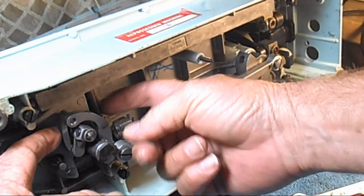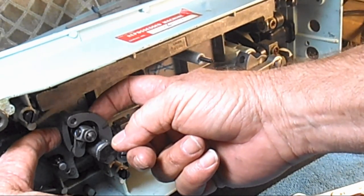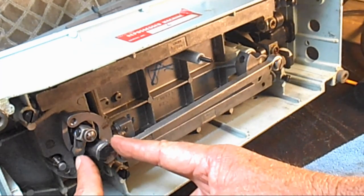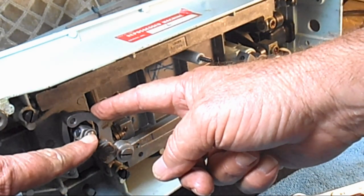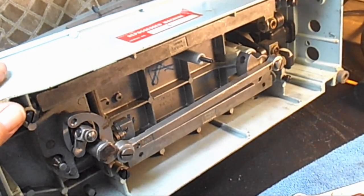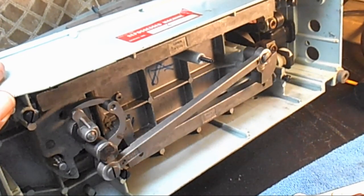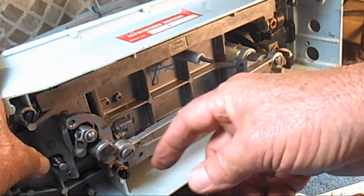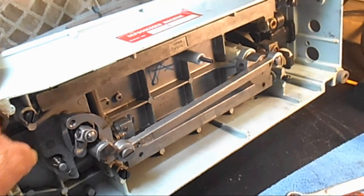So we put the back nut on by pressing down from the hook from up above. We got that nut tight. Then we put our bell crank on here and pushed it up tight while we put in the set screw, matching it up with the V groove, the timing mark. So I'm just going to spin the thing here and see how nice that is. Once you clean it up and put it back in, you're going to have a lot smoother operation. And you might have a little bit of play in this system just from wear. So it's good if you take it off and clean it and put it back together.